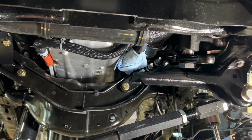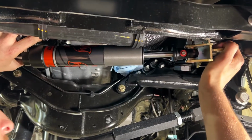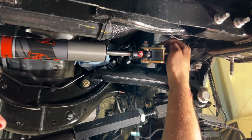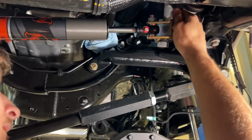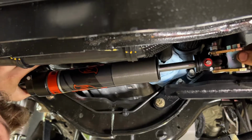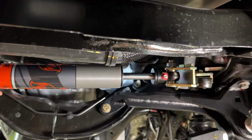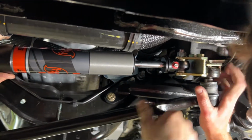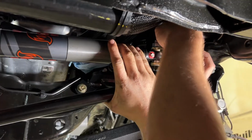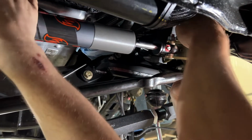With the drag link installed, we've now got our ATS pre-assembled. And we're going to slide that in, the pitman arm bracket over the pitman arm, and then on the other side we're going to go bolt, big washer, the ATS itself, and then another big washer, and then the frame side bracket. I'll show you that. This will be easier if I come in now with the drag link. And then install the original nut back on top.